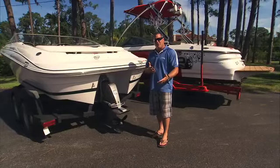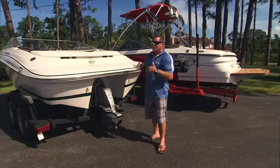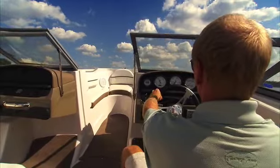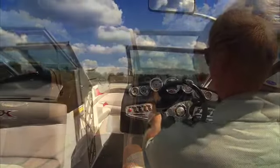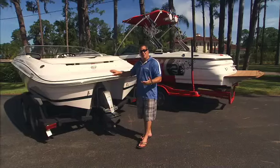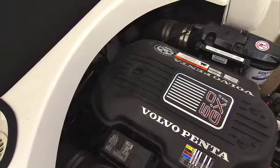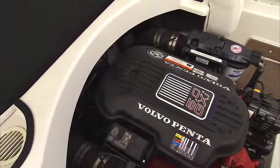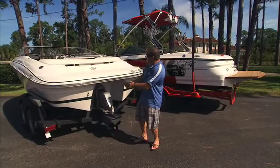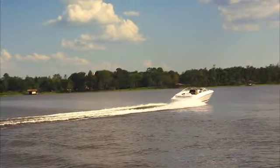The second topic in safety is bow rise. This boat, being an I.O., typically will have eight and a half degrees of bow rise versus what you get with a V-Drive, which is going to be four degrees of bow rise. The reason is that the motor has to couple all the way back to the very back of the transom, plus a lower unit. When it sticks all the way out — being the farthest thing from the back of the boat — it has to literally lift that whole boat up until it gets enough pressure to plane and drop over.